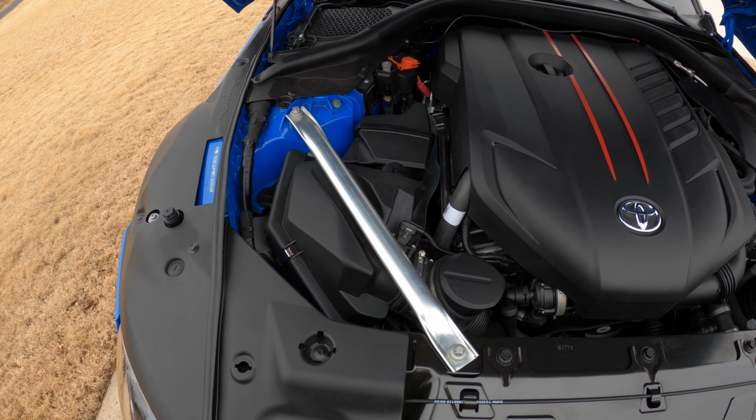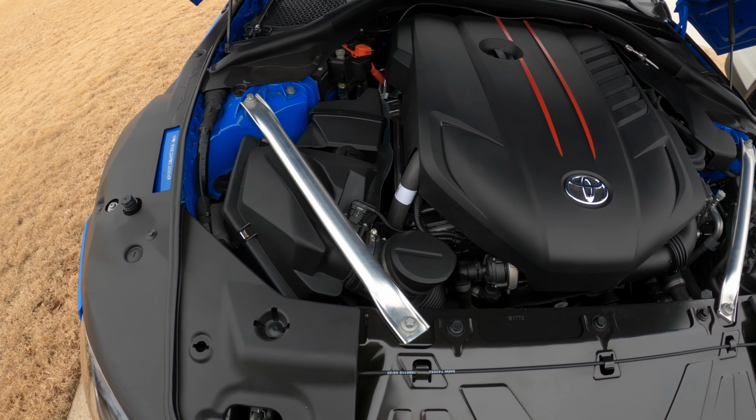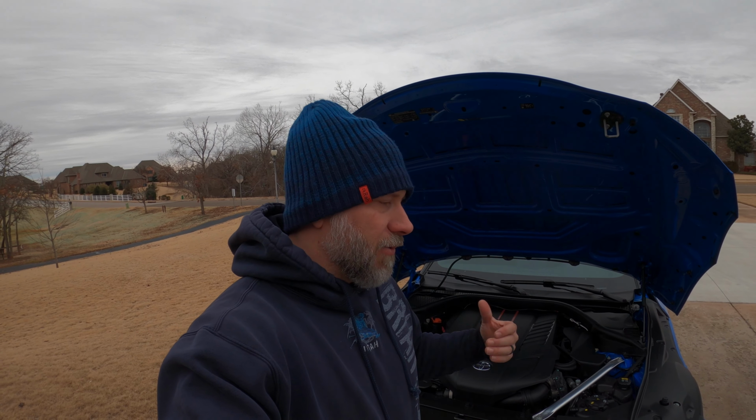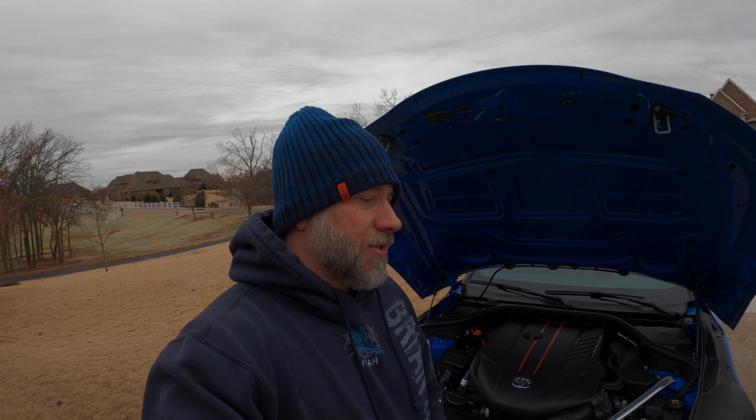If you guys have any questions, Speed Industry actually did a really good video showing how this is done. So if you're looking for an intake system, don't be looking for one to improve performance. You aren't going to get much, if anything, out of a swapped out intake. As a matter of fact, some dynos have shown a small, like 5 to 15 horsepower increase, while others have shown a 5 to 10 horsepower decrease going to a different intake system. So be careful with what you're getting.